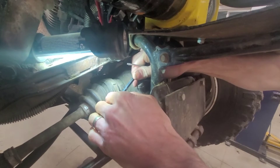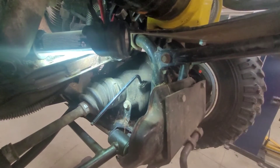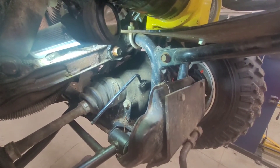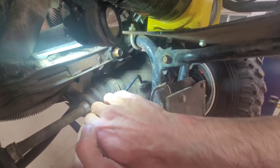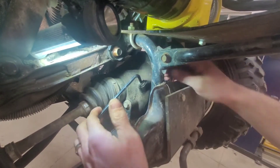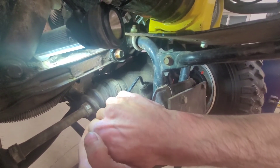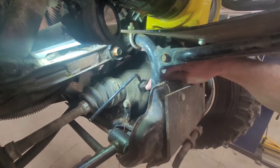It's nice and tight. Okay, so that's quite tight. This is exactly the reason why you want to make sure you crack this open first — because if you run into an issue and can't put oil back in, that could be bad. I might have to apply some heat and heat up the case a little bit.